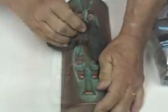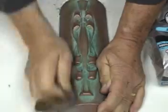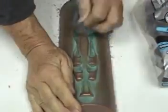You always want to apply your patinas while the final coat is still wet. Here Ron is misting on a light coat of light green patina. Light green patina tends to result in more of an apple green look rather than the more blue-green look of the Tiffany green. Once that patina has been applied, as the final C coating dries you'll notice the copper coating starting to turn, and over the course of a few hours we'll get a vibrant green patina. Since we've used the C coating, we can sand that back and buff and polish it to a high shine while leaving green patina in some of the recessed areas.